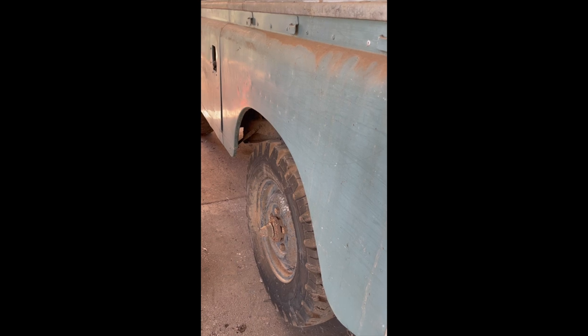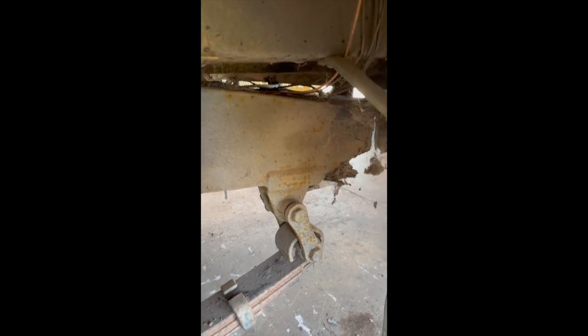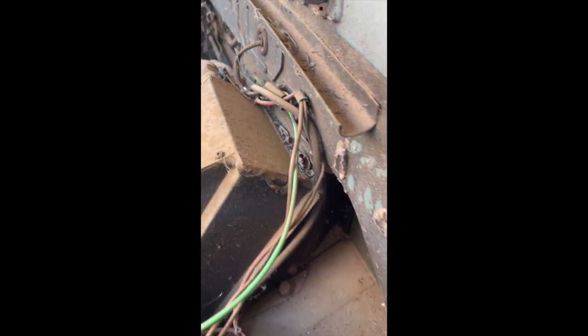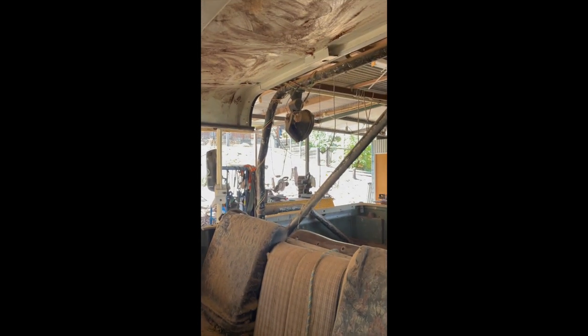This body's nice and straight still. The forward-most rear outrigger is not too bad. I can't see any repair marks on the chassis either, which is good. As we know, the rear one is almost completely gone. There's a lot of wiring that's straight up against the chassis that may need to be looked at. The body's pretty straight. Back to the engine again — this is some of the extra wiring that's been put in for some reason: two wires that go straight to the battery, then go downwards and back up and feed the rear light in the back.